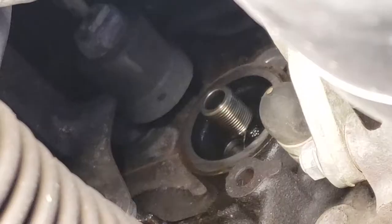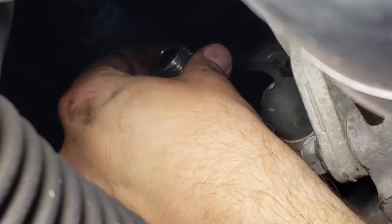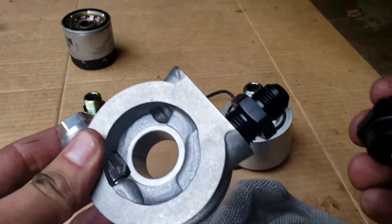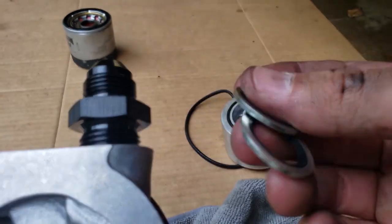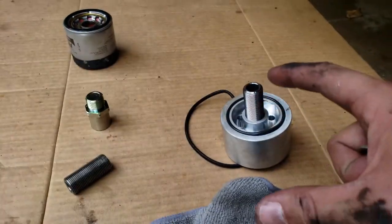Once that oil filter is off, you can take off that threaded fitting — the threaded pipe right here. The kit comes with a new one; that one's way too short anyway, and the instructions say you're not going to reuse it. You can get it out of there however you want. Before we install all this, we're going to put these fittings on. The kit comes with two different fittings, and the ones that go on this piece are the 330s. These ones don't have an o-ring in them like the other ones do, but your kit comes with two bonded washers. We're going to oil these up a little bit, put them on, and tighten them down.